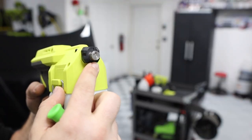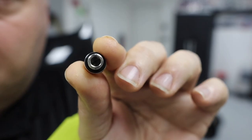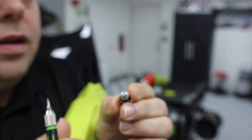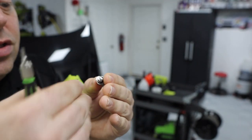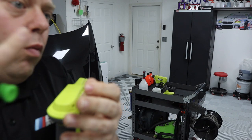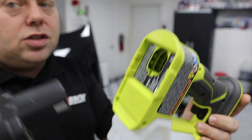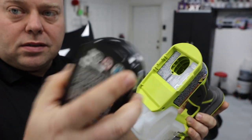Here's how to adjust the nozzle. The little nozzle comes off and, like foam cannons, there's an orifice inside. This little piece has a flathead and it changes the amount of water that can get behind it to shoot through the hole. Turning it a quarter or half turn gets you a wetter stream; go out further and it shoots a straight stream. It is adjustable, but it's a pain to adjust. Battery clicks in and out with little buttons on the side.